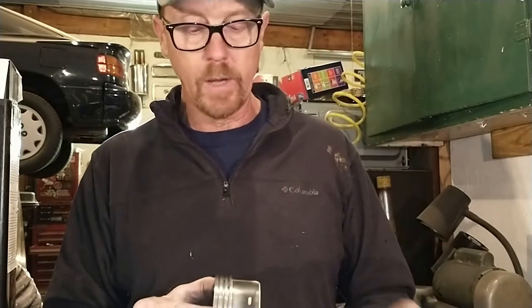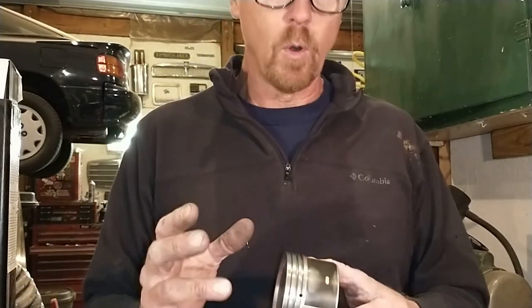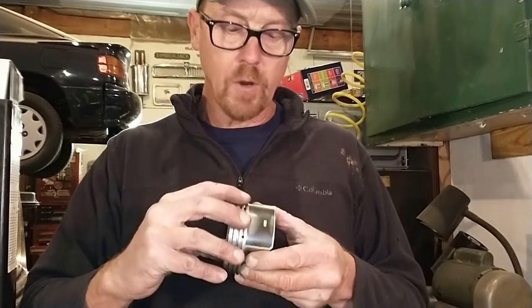That brings up the most important point. I see a lot of engine rebuilds done where people take an engine apart because they had a problem, and then they want to buy new pistons. I look at the pistons and say there's nothing wrong with these pistons. From a machinist point of view, the question is: does it meet the specifications of something that will run in this engine? Engineered parts have to meet certain criteria to work properly. The most important thing when dealing with a piston is we need to trust our feel — if we feel an edge, the engine is going to feel the edge.